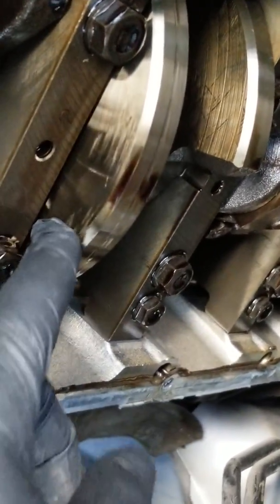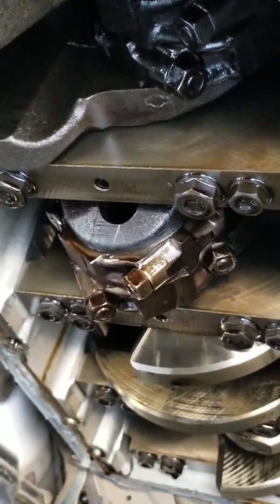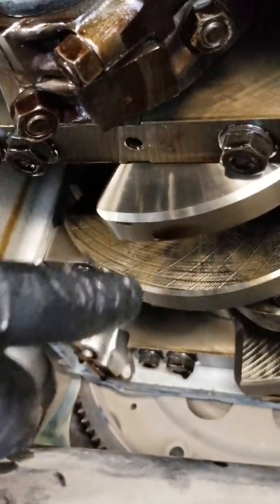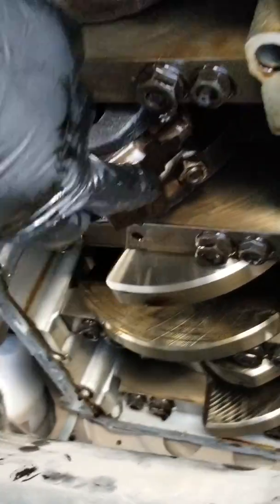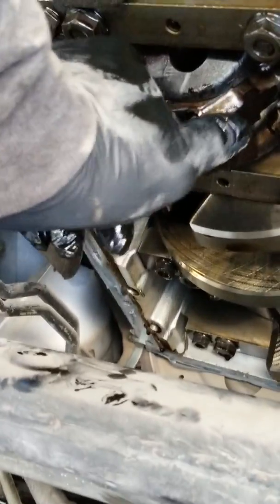You can see some scoring on the actual crank. So for sure it's a rod knock. We've got cylinders one, two — I don't know if you can see up in there — three, four, five, six, seven, eight. If I grab cylinders one or two, there's no movement, no play. But look at this — you hear that? See that? There's your rod knock. You can imagine with this thing going at 2,000, 1,500, 1,000 RPMs — look at that play.